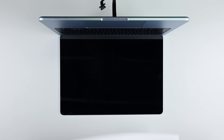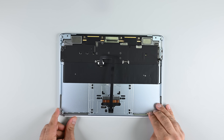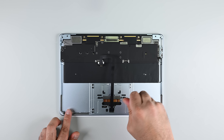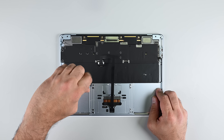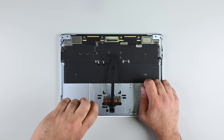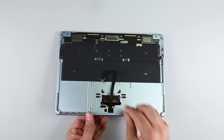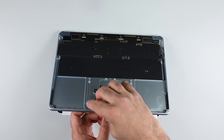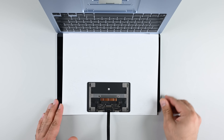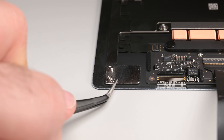The next item I want to remove is the trackpad. This is a fairly easy if tedious process. The best way to remove it is to place a sheet of paper between the screen and the keyboard and close the laptop. After removing the 10 screws holding the trackpad in place, open the laptop — your trackpad should be sitting on the sheet of paper. Pay careful attention here: there are several spacers around the trackpad screw pillars that I somehow manage to lose every single time I've done this.